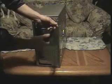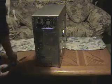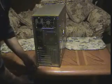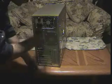The first thing you're going to want to do is take the covers off. There's usually only two screws, so we'll take those screws out. Now to access your hard drive, you're going to have to pull both covers. Two screws on each cover is all you need — you don't have to take all of them out.